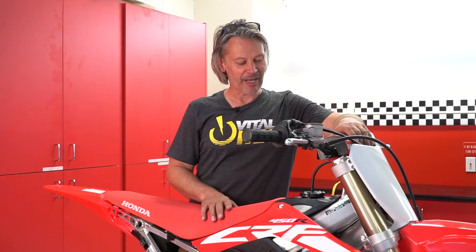So that's it for that tech tip. It's really simple — just by re-torquing the engine mounts on this bike you'll find that it will improve handling, and it's almost as significant as having your suspension refreshed. It's that good, so I really recommend doing it. Also if you're the type of rider that likes to experiment a little bit, you might try altering the recommended torques by say five or ten percent and see if there's a setting you'd like to come up with. Just by doing that you might find some additional flex in the frame that gives you more rider comfort.